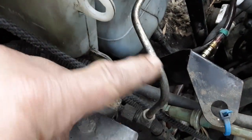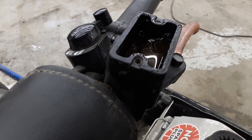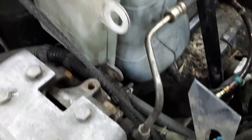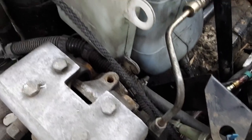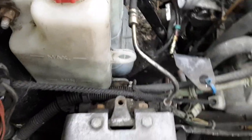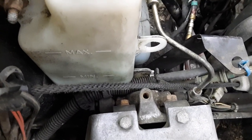So either I've got blockage in the tube here — this is our feed tube — or there's blockage in here or it goes up underneath the handles up to the reservoir. Next I'm going to try to break these lines loose — not really break them, I don't want to break them — and see where the oil is coming from and where it's not. It should be leaking out from some portion; especially if I pull the handle I should have oil coming out of that hole there.